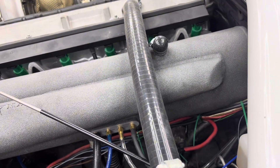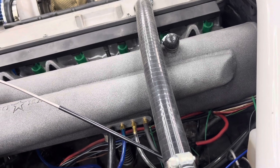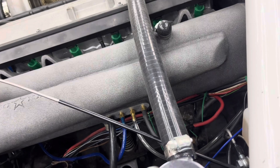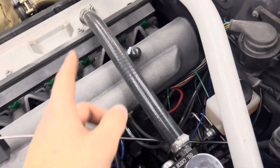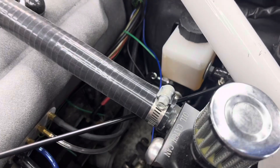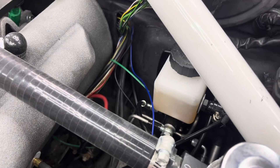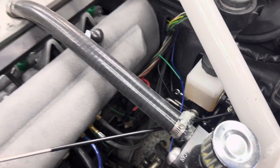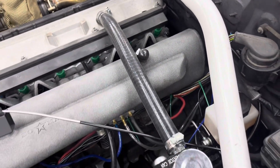I don't think it'll burst or anything with the boost pressure, but if it does, this intake manifold is aluminum so I could just weld that up. The reason I'm not running that port is because I have a Chase Bays brake booster, and that booster doesn't require a vacuum that that bung would provide.